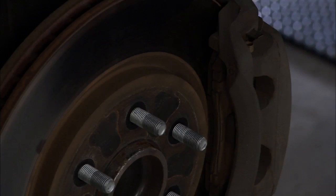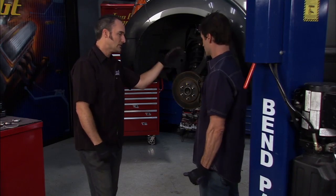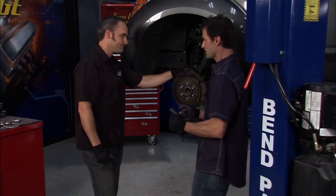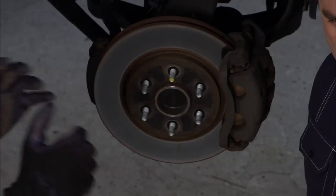The first thing I notice is the pad's got some life in it, but it's probably been overheated. We've saturated this rotor — time to replace it. That heat a lot of times will warp it and give you that kind of shake. There's a lot of casting residual stress in here. You get the temperature hot enough and that metal can start to move around.